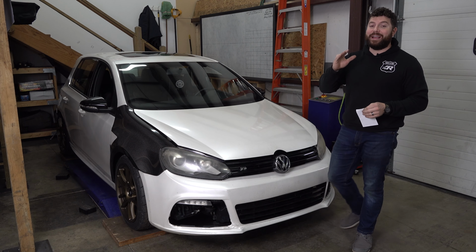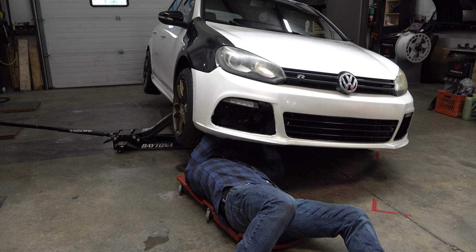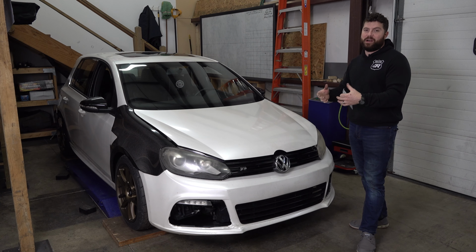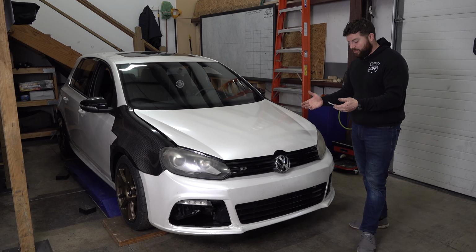So Friday, I come in, I get the O-ring installed on the lower charge pipe. That was a big vacuum leak, and it's kind of a problem area on factory vehicles as well, just that O-ring and that fitting's kind of loose. I know I had a big vacuum and boost leak there. It would pop off anytime you made any boost. Car would run extremely poorly after that.